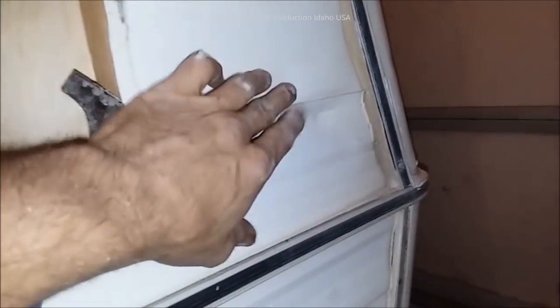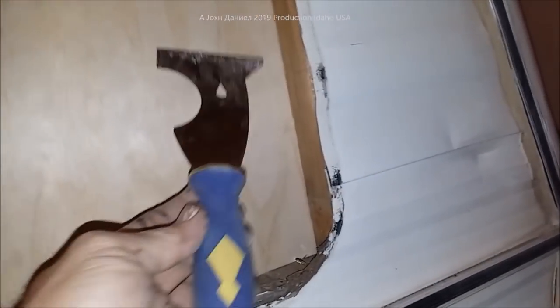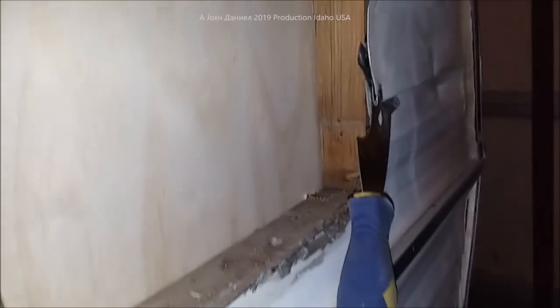Even though this trailer has a few dents and dings, we use this putty knife multi-tool paint scraper because it's got a very good edge — just harbor freight tools. You can see there's a seam right here where the metal goes under and laps, connecting one to the other. I'm going to put it in there and pop it with my hand to lift the seam, then my metal coming down will fit underneath. I'll run it behind until it reaches the edge and put three good strips of sealant, which reduces the area for moisture to get in and gives me this two-by-two piece to screw to, making it completely waterproof.